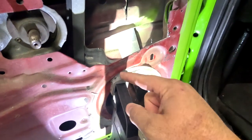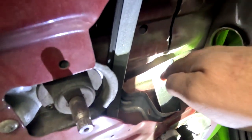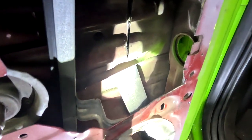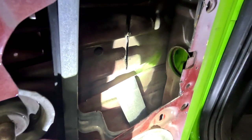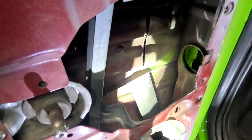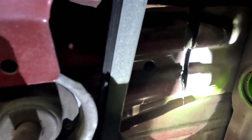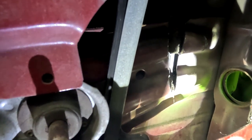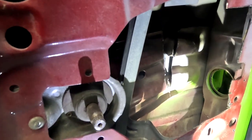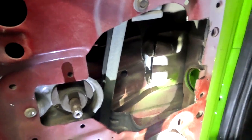I think we got it figured out. We took the bolt out of this bracket, which normally sits here, and bent it over a little bit with a clamp holding it. One thing I want to point out: I have a quarter-inch piece of flat stock that I'm putting behind the crash support, in between the door and the bar. So if I get a little aggressive while cutting, it'll cut the flat stock and not screw up your door. Definitely optional, but if you care about your paint, probably a good idea. I've got about three-quarters — actually probably more than that — cut. I'm wiggling it on the back here, hoping the metal will fatigue and crack. It looks like it's starting to tear, so we're going to try this method.